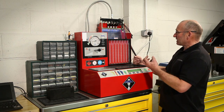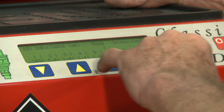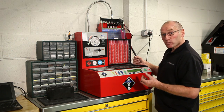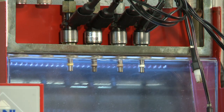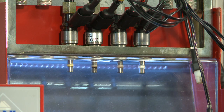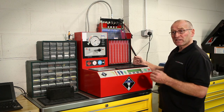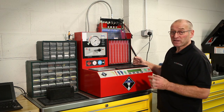Inductance — let's have a look at the efficiency of the coils here. 1.4, 1.4, 1.4, 1.4. So the efficiency of electrical energy creation within the coil of each injector is perfect. That's just gone to 1.5 — that's not a bad deviation, I'll accept that. Back to 1.4. In other words, the performance of hydraulic delivery will not be affected because the inductance of each injector is identical. If the inductance varied dramatically, then its hydraulic performance will vary also — and that's not good news.